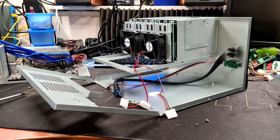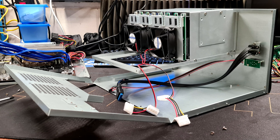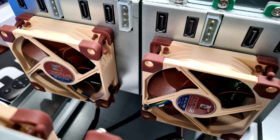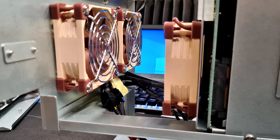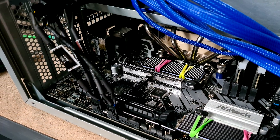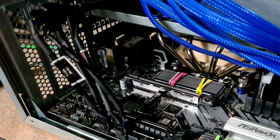To install or replace the fans with the Noctua fans, you need to disassemble the chassis a little bit, but luckily it's all built together with screws. This meant that after removing a bit of the frame, you can actually bend back part of the frame itself to be able to access the back part of the drive base. There you need to take off a metal cover to unscrew the old fans and attach the new ones. It's a pretty easy swap, and using the included two-fan to one PWM headers that come with the Noctua fans, I hooked it up in pairs and gave each their own fan port, which is then controlled by the motherboard, ramping up and slowing down the fans depending on the temperature.